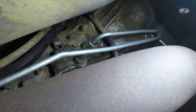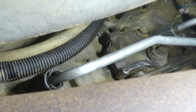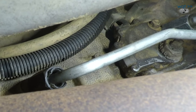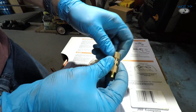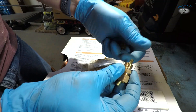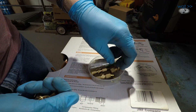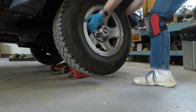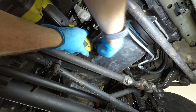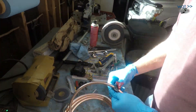One other thing I noticed: last time I replaced that fitting and it's in great shape. But this fitting that I reused — it's seeping. So I might as well go ahead and replace that too. It was only 12 bucks and it's not that hard to get to. Now, these are brass compression-to-compression fittings for three-eighths. I'm not using polyethylene tube, so I don't need the inner pieces. Actually, we don't need any of these pieces — this is not the right way to repair your cooler lines, and we spent the better part of two hours and a not inconsequential sum of money learning why.